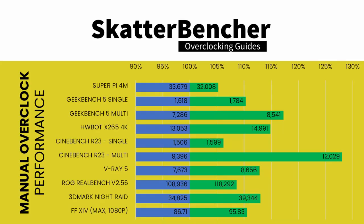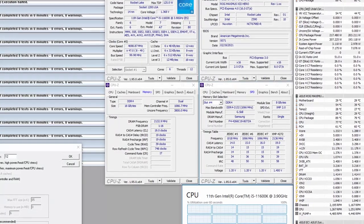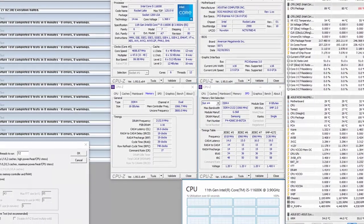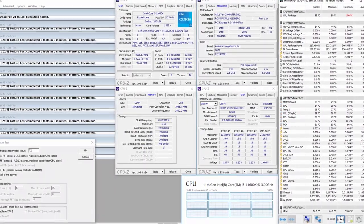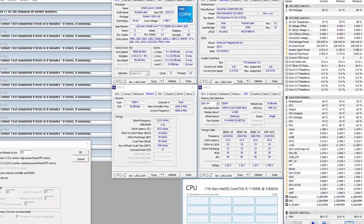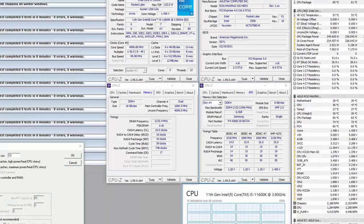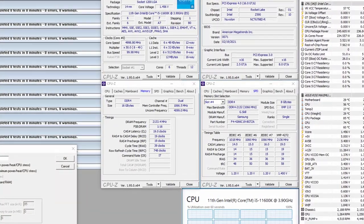We re-ran the benchmarks and checked the performance increase compared to stock. In the majority of benchmarks we reach our best performance results. When running Prime95 Small FFTs with AVX enabled, the CPU operates stably at 4.6 GHz with 1.354V; average CPU temp is 89°C, VRM temp is 52°C, water temp is 29°C, and CPU package power is 218W. With AVX disabled, the CPU operates stably at 5.0 GHz with 1.458V; average CPU temp is 85°C, VRM temp is 56°C, water temp is 30°C, and CPU package power is 246W.